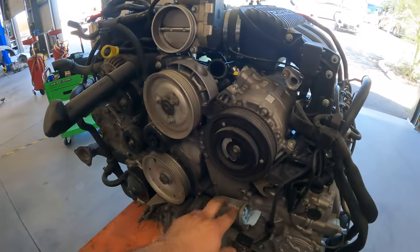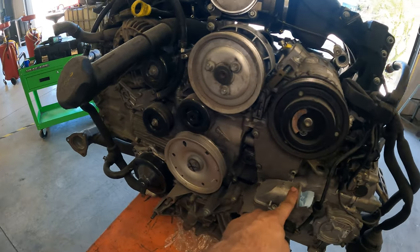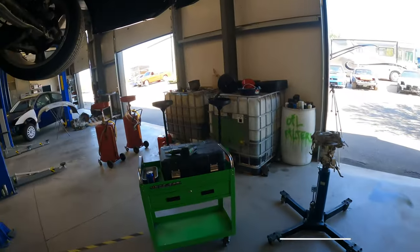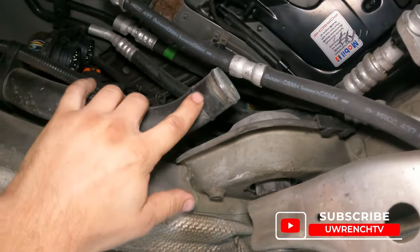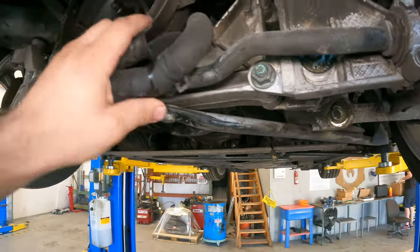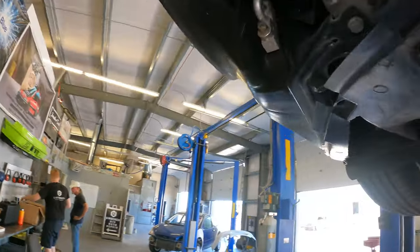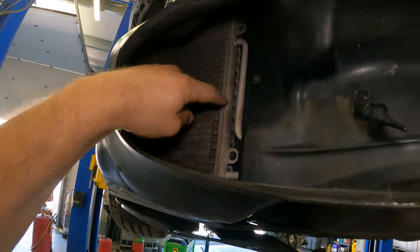These hoses actually, the bigger coolant hoses, where is it? There's this one, and then there's one over here somewhere. There it is, down in there. Those ones, they were really stuck, so I had to cut them off. And he got new hoses for us, but we're gonna see, because this is where one of them goes, and that's another one. We're gonna see what hoses he got. I'm kind of having a feeling that he got hoses for the front radiators, which are up here. That's the AC condenser, but the radiator's behind it. That's that black thing.